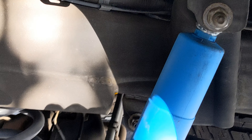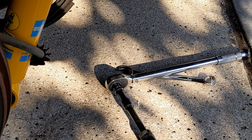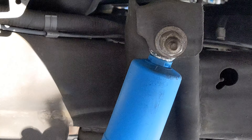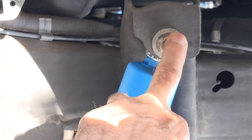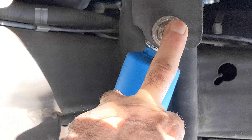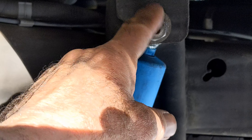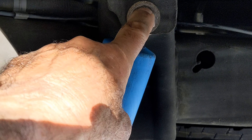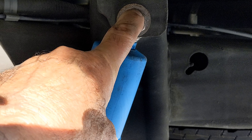Here's a tip: always check your torque wrench before you start torquing something, because I didn't, and I had the wrench set for 125, which is for the lug nuts. By the time I realized that, I had this one tightened up probably to about 100-ish, which is okay — it's not going to hurt anything, it's a really big nut and bolt. But I was struggling wondering why I was pulling so hard for 85 pounds, and then I realized the mistake.